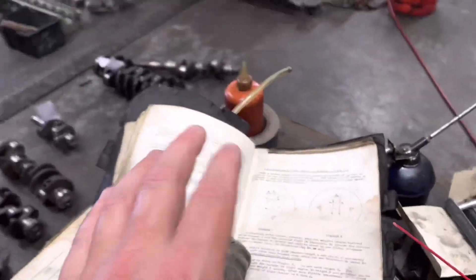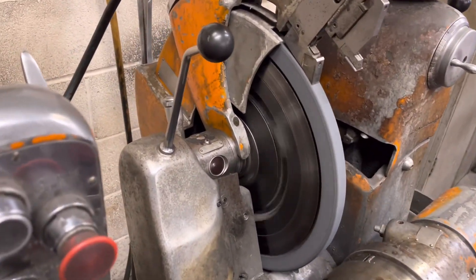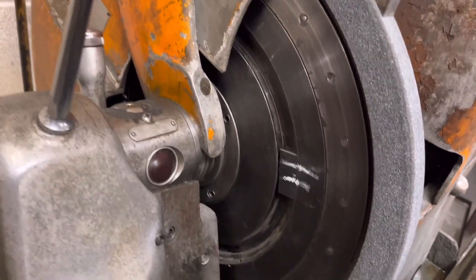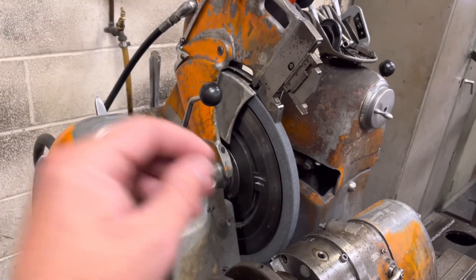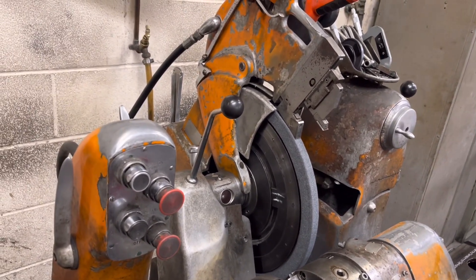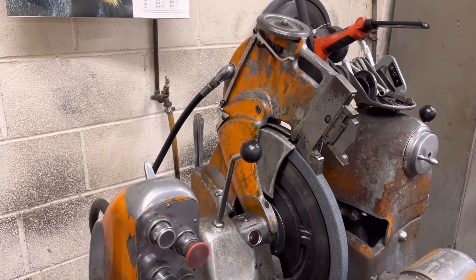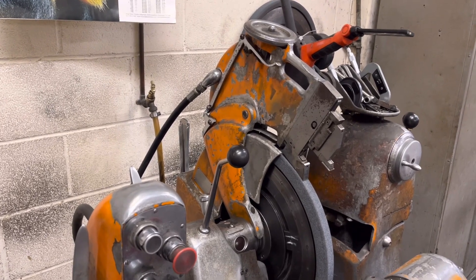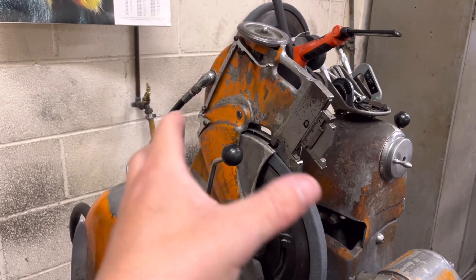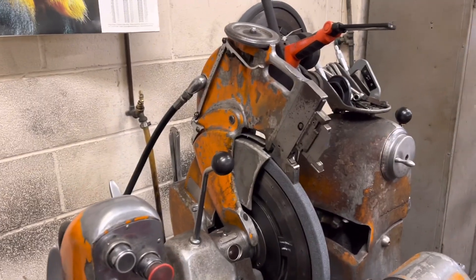You start out with all the weights evenly spaced. There's one of the weights there and two around the other side. It's just a case of moving a weight one way, seeing what it's like — whether it's worse or better — then moving it the other way, then back to the centre, then you do another one. It's basically a process of elimination, and it can take quite a while — it took John nearly an hour to balance this wheel. It's frustrating because you move one weight one way and it gets worse. And sometimes you can get all the weights almost right, but no matter whether you move one weight or another it doesn't get any better and just gets worse, so you have to move all the weights and almost start again.